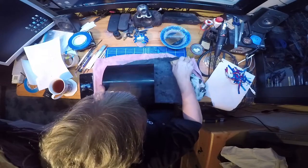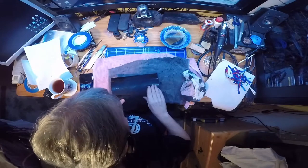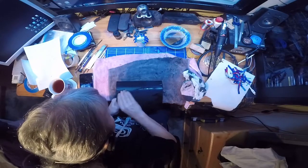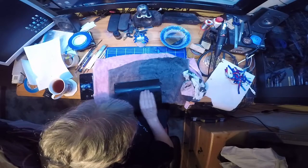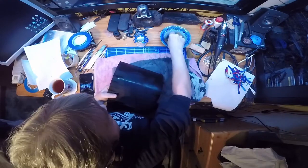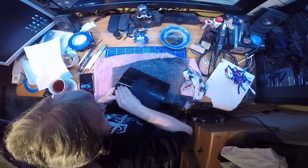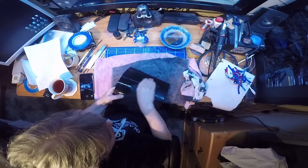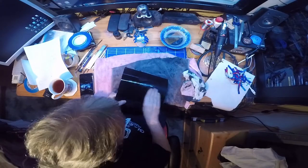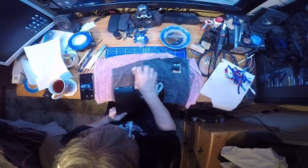Right, for the main bit of cleaning off, that will do us. Get the wooden block out and we'll just use the wet and dry as it is, just to flat down where the slight undulations might be, so we don't break through the colour coat. And I sprayed this 2.5 days ago, something like that. See how that looks. Looking good.